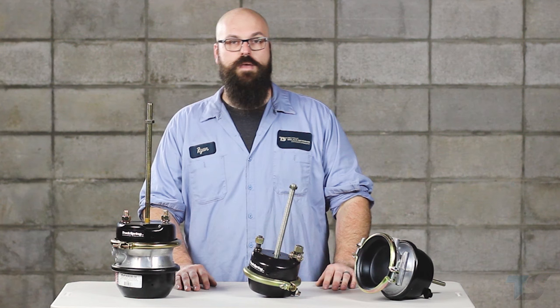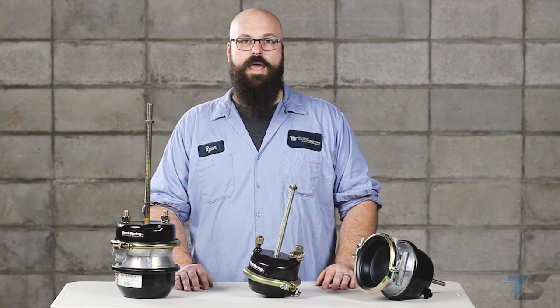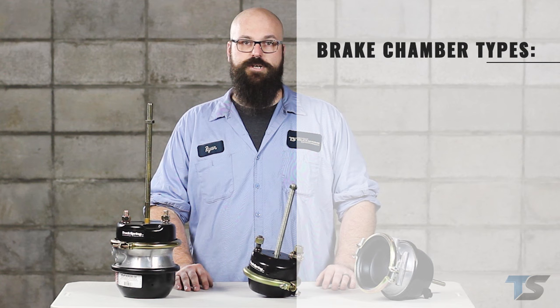In this video, I'm going to talk to you about brake chambers. Brake chambers are used on heavy-duty trucks and trailers to convert energy from compressed air into force used to apply the brakes. There are two main types of brake chambers used, service chambers and spring brakes.